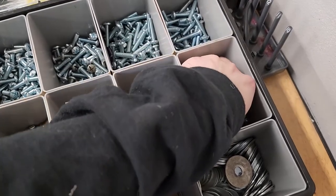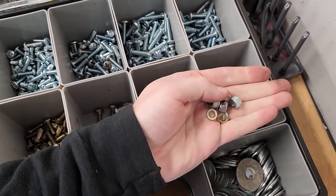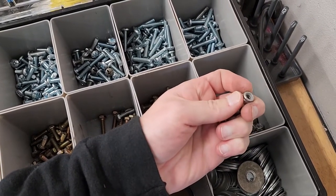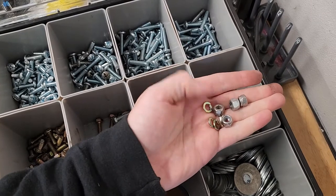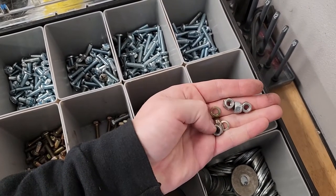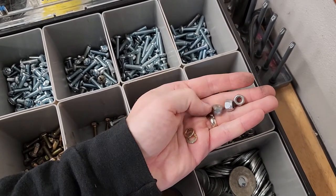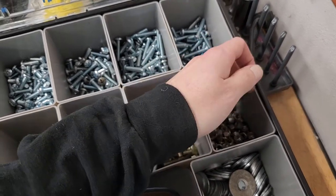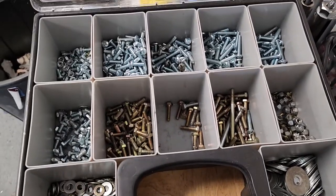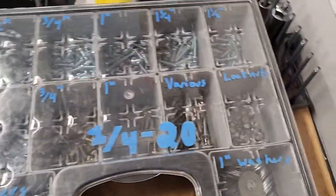For locking with new non-OEM bolts, we use Nylock almost always on nuts. So you see the nylon in here. We have two different grades of these as well. We have some stainless ones and then grade 2 or grade 5, and then you see the grade 8 split lock washers as well. So we use both a lock washer as well as a Nylock whenever we're using aftermarket bolts. And then all our kits just come like this.